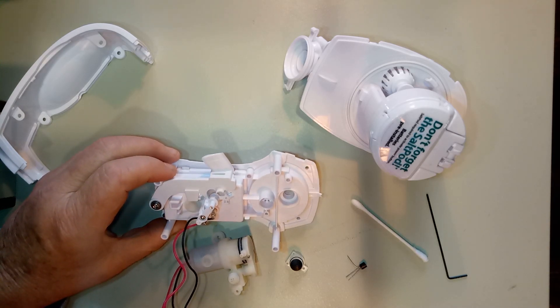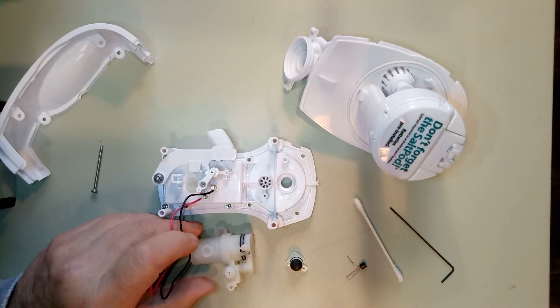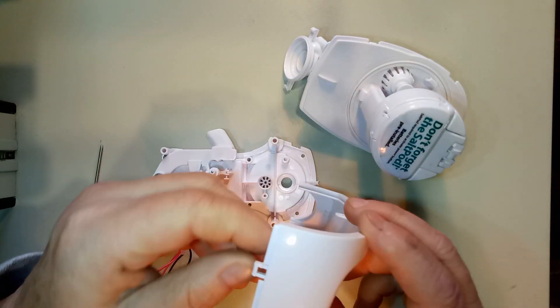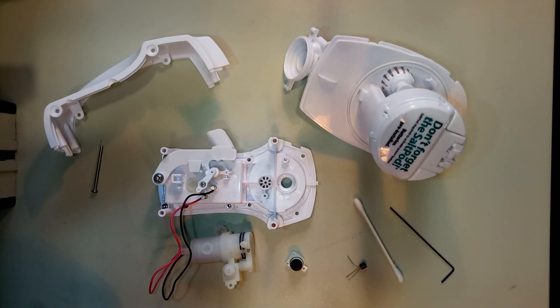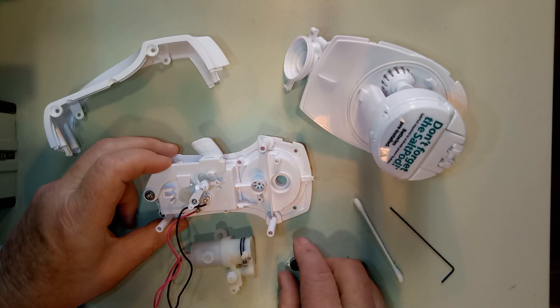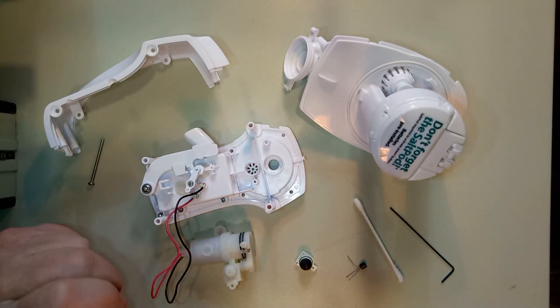It can very easily water-lock, or if you're shaky or splash around a little bit, get some salt in those holes, and after a while it may not work as well. I only recommend this for people with good mechanical aptitude — all these assemblies are a little tricky, so just be gentle. Open it up from the back; there's a little tab, you'll see light shine through, stick a knife in and pry gently, keep prying around. Be careful and you'll get it apart and back together. It seems rather easy to lock up that pump motor. Hope this helps — at the very least it's an interesting look at what's inside. Thanks for watching.